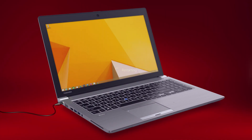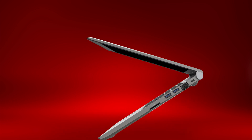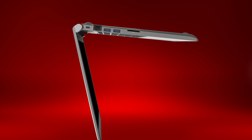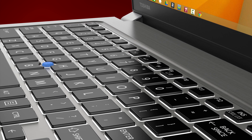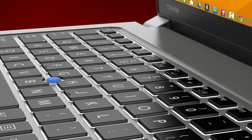If it's still having problems, try cleaning the keyboard. Turn off the laptop and unplug all cables and connections. Leave the laptop in the open position so the keyboard is still visible. Turn it upside down and very gently move the computer back and forth to dislodge anything that might be stuck under the keys. If you see anything sticking out, you could remove it. Note that if you attempt to remove the keys, it's possible you could damage the keyboard.